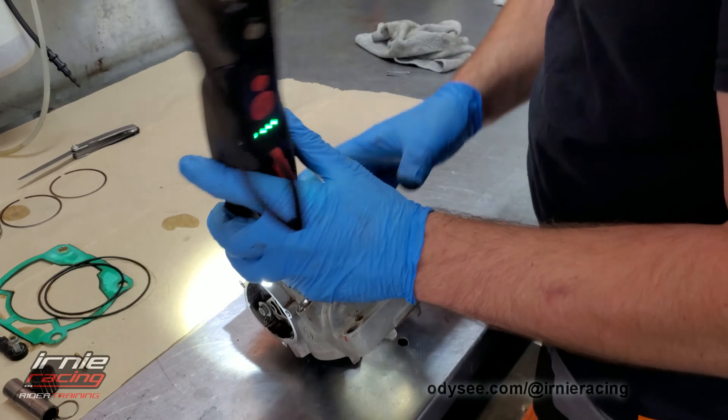Have you ever adjusted your power valve? Yes, I have definitely adjusted the power valve. I run it 2.5 millimeters from flush - normally it's way in. So I've turned it out three or four turns and it runs way better. Once I did that, it actually gives you a mid range and a low end. I'd measure it from flush essentially - how much it's in or out, because you lose track of how many turns you've done if you play with it a lot.